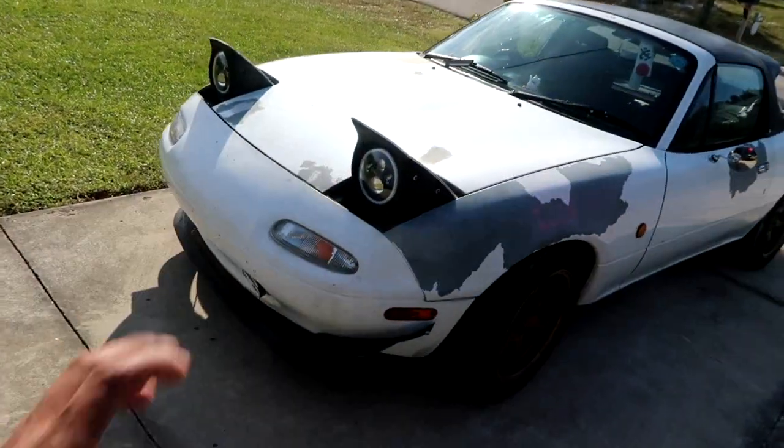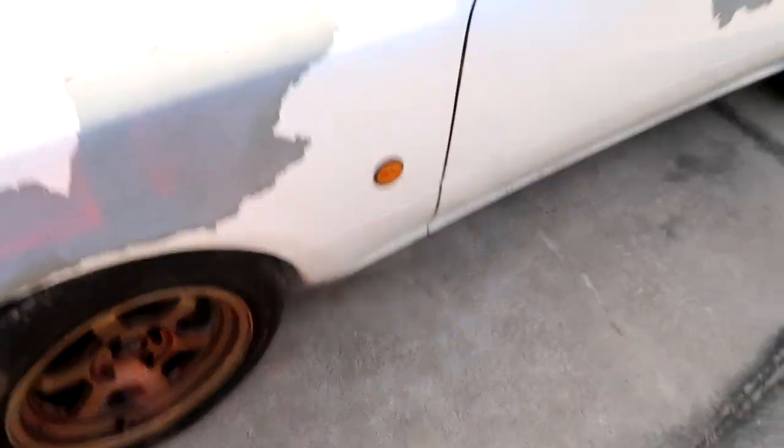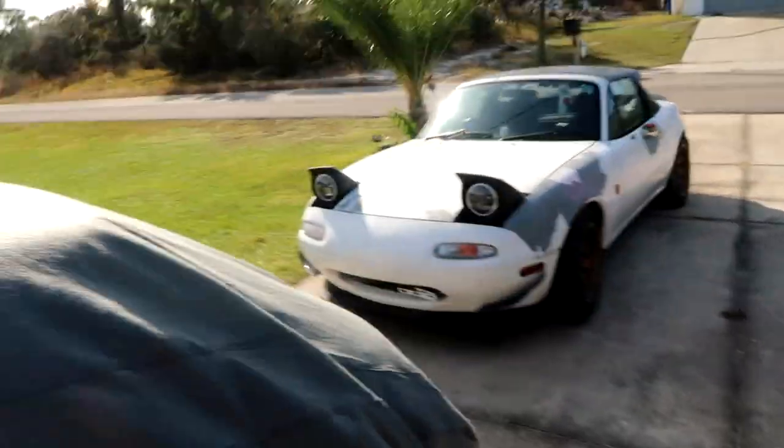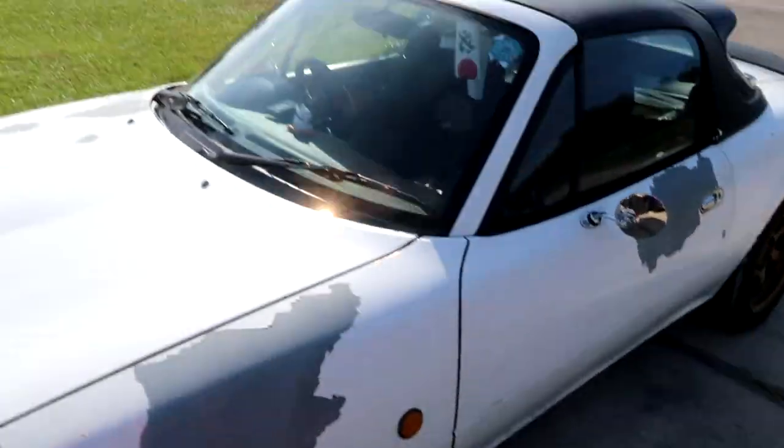It is leaking a little bit of gear oil, but that's no big deal. As you can see, there's like a puddle down there of gear oil, so it's leaking quite a lot actually. Oh, there's another one. Yeah, it's leaking quite a lot, so I guess it's a good thing that it's going to the paint shop. Once I have it painted, then we'll fix the whole transmission issue. I'm pretty sure it's coming from the input shaft, but we're gonna worry about that once it's painted.